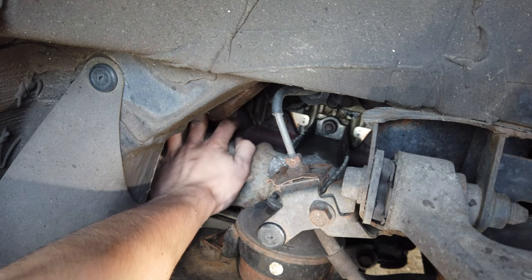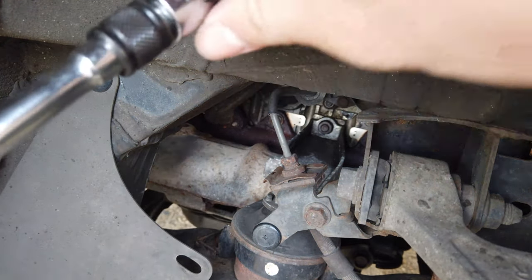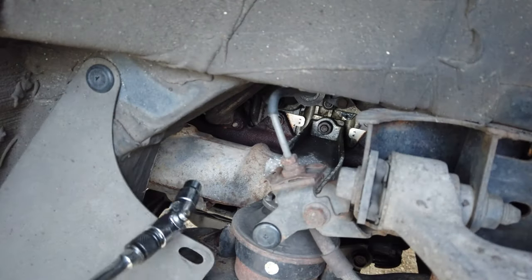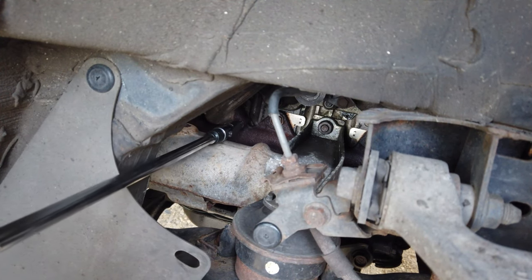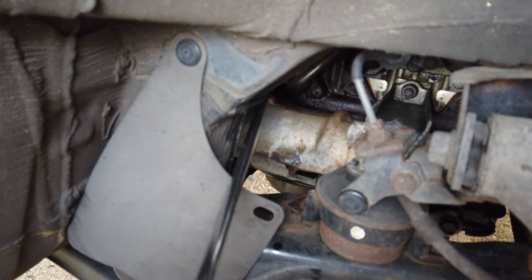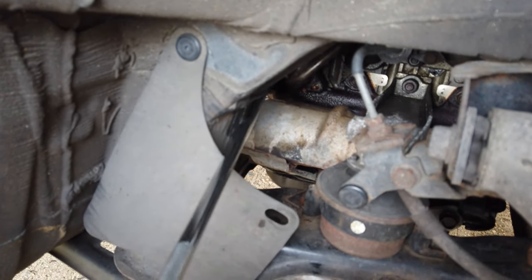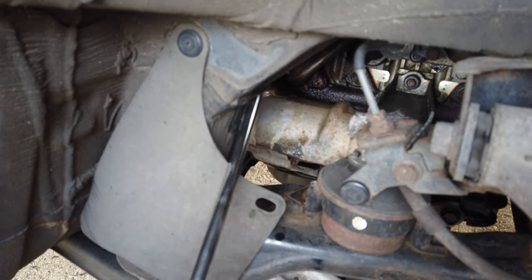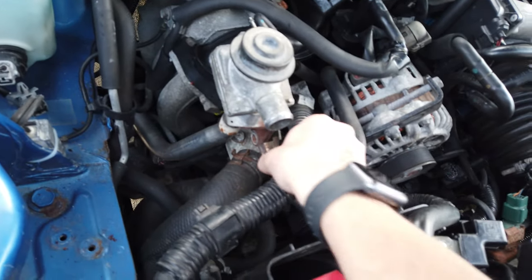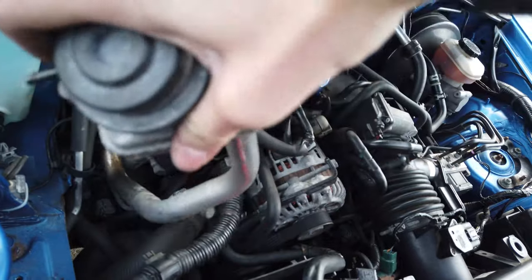Back there are two bolts — that's what we want to take out and put the plate in over where those bolts go. You want to grab your super long extension and ratchet — I have a swivel head on mine and a 10mm. These might be hard to come off, they look pretty rusty. I managed to get the second bolt back there with the swivel socket — you can't do this without the swivel socket because you will not be able to reach it. The other one was a nut and this one's a bolt. Now we can come back up here and actually pull this out, just like that, and it's out.